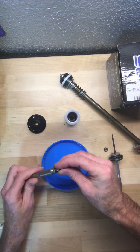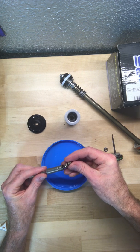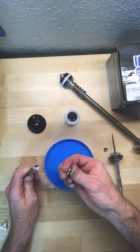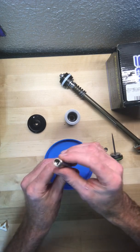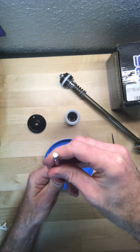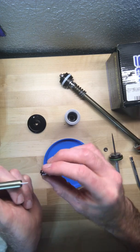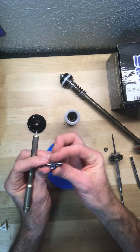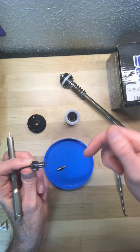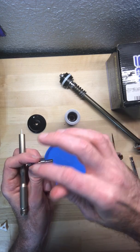This is a detent-style clicker with little ball bearings on the inside of it, and those suckers will fall out on the floor, so I have to be careful. It's just like a tip of a screwdriver, and it will thread this needle up and down inside this tube. You can see this is a needle, and the further that goes down, the more it will enter into this hole and block off fluid from going through that hole and out the sides.